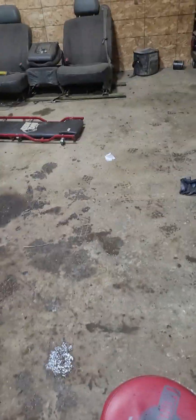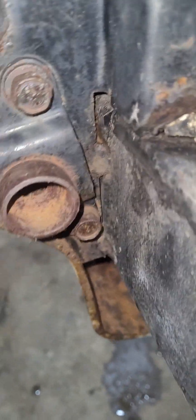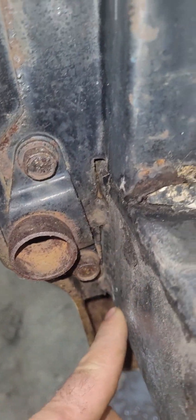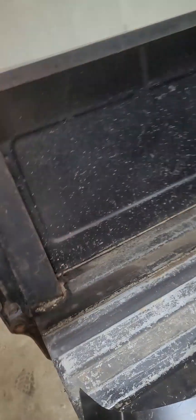If not, and if you're here wondering how to take a box side off — you got to take all those bolts I just showed you, plus all the ones underneath. Then you're going to come along here and you're going to have some weld. The weld's going to be along here, along here, and in here. So you have to take a grinder, zip cut, whatever — cut all the weld — and then with all the bolts out, this whole box side should fall off.